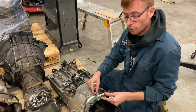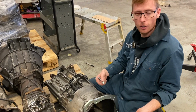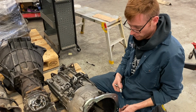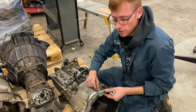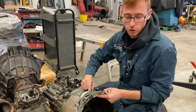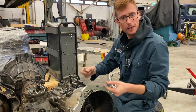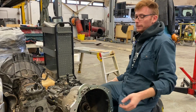I sometimes go around them first with the plate off, put all the bolts in, you know, and work it out. Nice and straightforward. Anyway, so put your bolts in, and the thing that we're obviously trying to avoid is you don't want the bolt to come right through and out the back, because if the bolt does do that, then it's going to push the adapter plate and bend it. So obviously choose the bolts carefully.